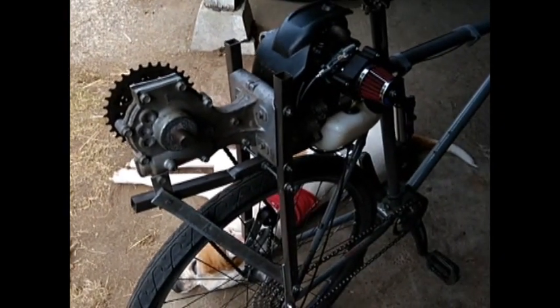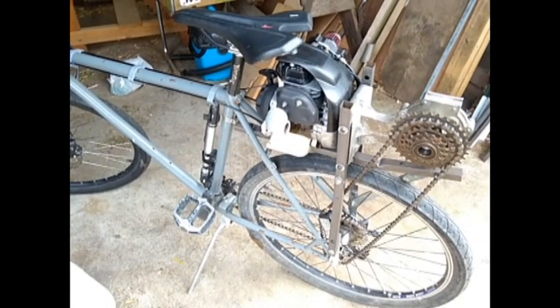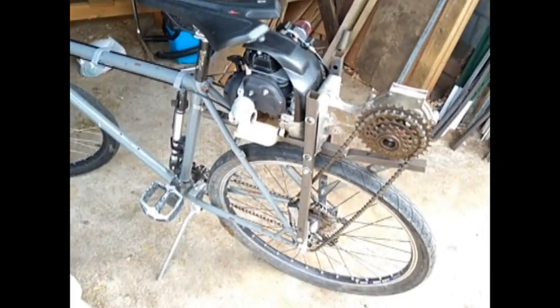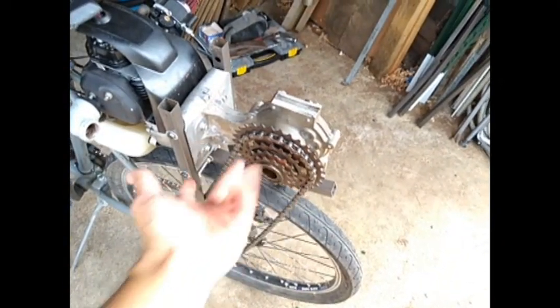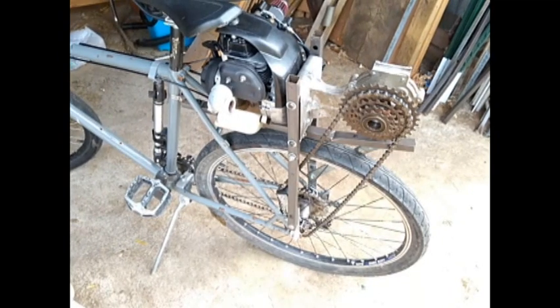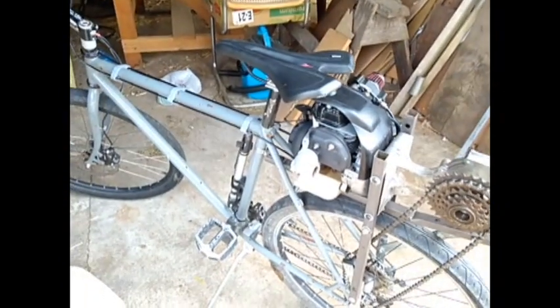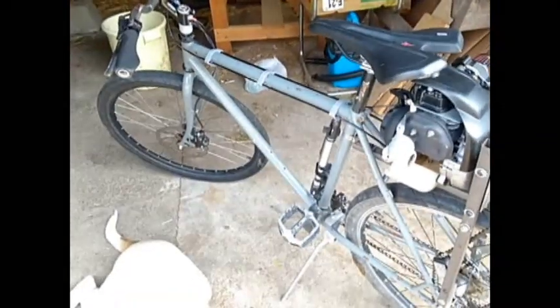If you're thinking about doing something like this, I would say go for it — it actually works pretty well with good power transmission. Worm drives can be upwards of 90% efficient. The only real trouble I had was making this adapter, but JB weld with a 5,000 PSI type seems to be holding pretty well — I don't think it's going to break. I think something else will break first. The motor seems to be running good, though there are occasional tuning issues. I couldn't start it the other day for some reason, took apart the carburetor, put it back together, and it started up — so I can't really explain what was going on there.